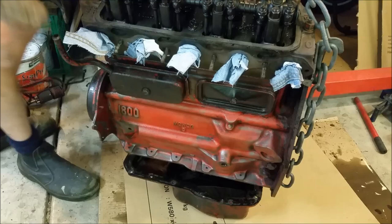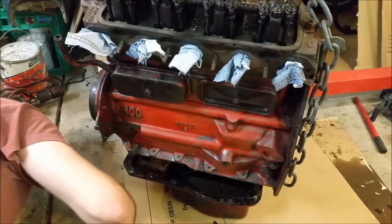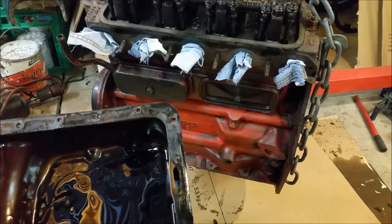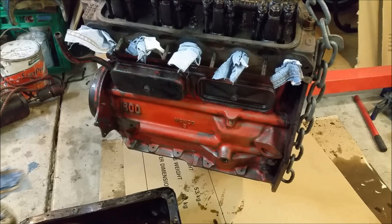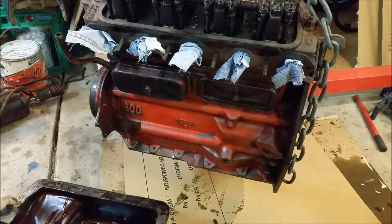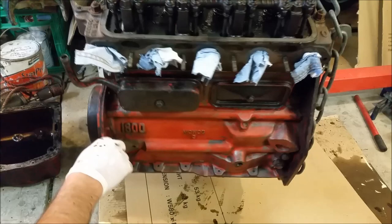Let's have a bit of a look. I've got to sit the engine on blocks of wood to save the strainer from hitting the floor — that hangs down quite a long way. That sump is pretty clean. All that's in there is oil, which is what we want to see. I'm just wondering where all that oil was coming out from. That must be for the older style rear main where it runs a slinger — this one has the seal on the back.